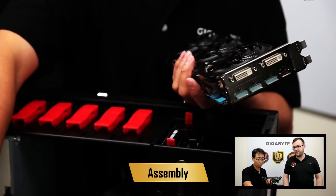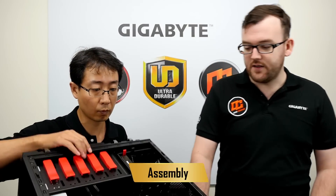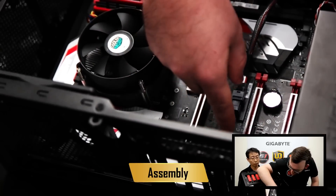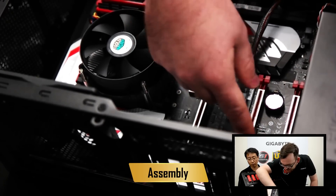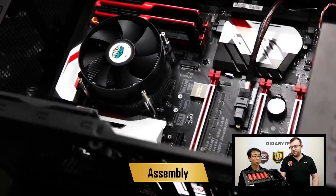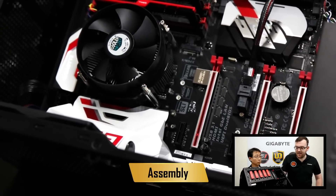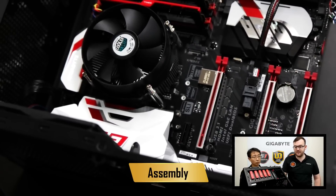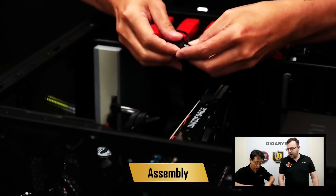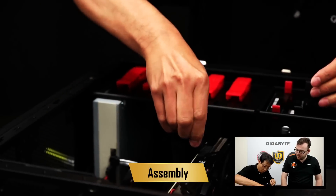It's time to install the VGA card. You can't just install the VGA card in any PCIe slot — if you look closely at the board, each PCIe slot has a number by it. In our case we have X16, X8 and X4, which shows what PCIe lanes are available. You want to make sure your graphics card is in the highest slot possible to have the most bandwidth to your card. So we're going to use the X16 PCIe slot. VGA cards also need power themselves, so we connect the power cables to the power connector on the card.